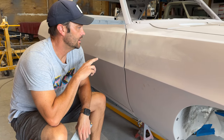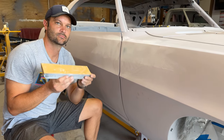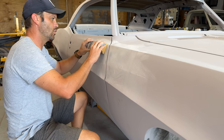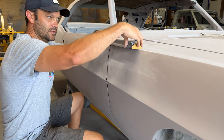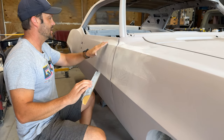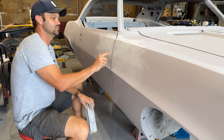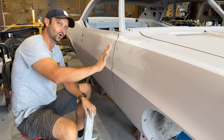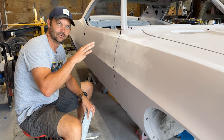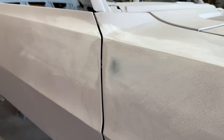So here's one of those specific spots I was talking about, a great example to show right here. You take this big flat block right here — the bigger the better. That's how you get your straightest absolute lines ever. What you do is you come up and over this edge, but you won't roll over the edge. You want to just bring that out and essentially cut that edge, keeping this metal nice and straight. So then from there, if we're just going through here between these two panels, it's almost like we're sanding one plane where it's really two panels. But when you're looking at this at a car show with bright, shiny, glossy, maybe metal flake paint in the bright sun, you're going to be able to see just how straight the spotlight line is coming down through here.